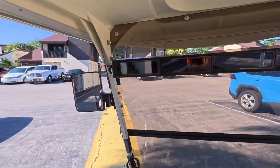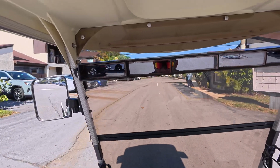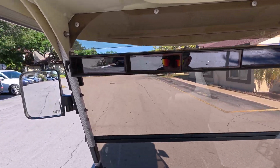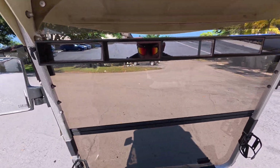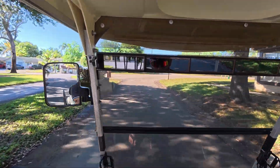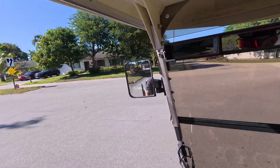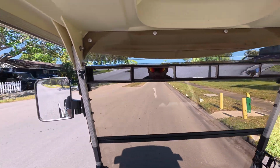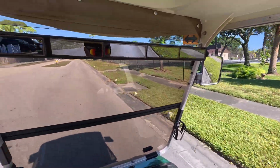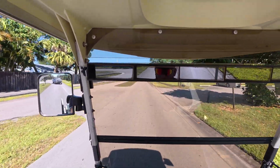Now, as you guys know, the 30 amp hour ones go for $350. That doesn't include any coupons, and you can get them directly from their site as well. Now just keep in mind, guys, that I had to purchase my own charger, which is the one that you already saw when I was charging each battery individually. And you can use pretty much any 58 point something volt charger to get these completely charged, and it works just fine. And after you charge each one of them individually, then you are all set to ride the cart and just charge it with the regular port.